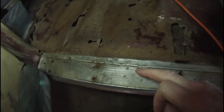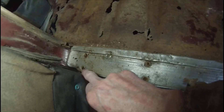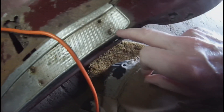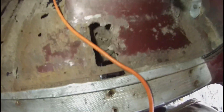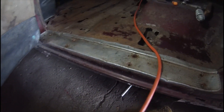I've yet to see what it's like underneath this trim panel here. I'm having a little bit of trouble getting the last two screws out. That one there is rusted to the point I can't get a screwdriver on it anymore, same as this one — I tried to drill it and it's either a very dull drill bit or a very hard screw. Anyway, I'm going to attack it from underneath. I think I can get under there with the little air die grinder and hopefully grind the ends of the screws off, then I can lift this trim panel off and see what we've got to deal with.